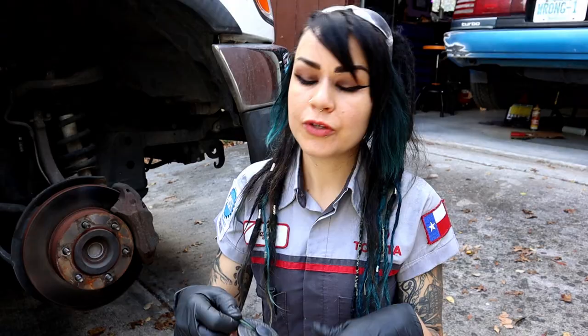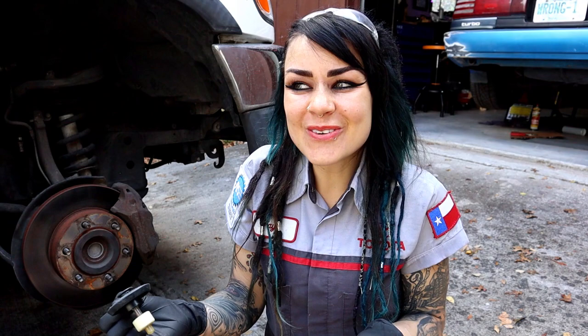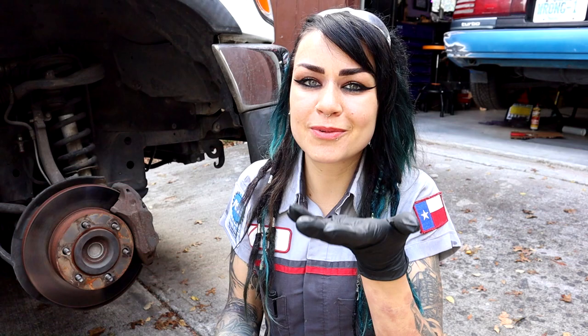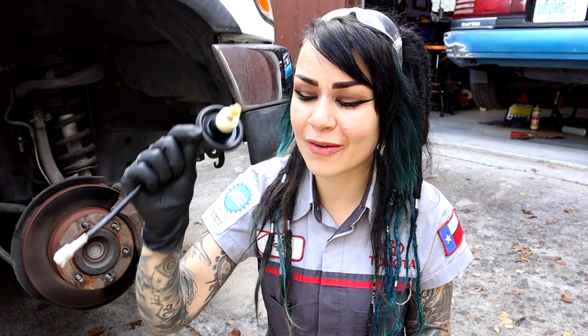Now why does this not work in most situations? When you go to a dealership or independent shop for an oil change and they do a full service topping off all your fluids, most of the time those oil change people don't know that the fluid level is really important and needs to stay at whatever it was. Also, when technicians replace your brakes or flush your brake fluid, they're often not going to put it back to the level it was before — they'll put it right up to full — so this is unfortunately not a good measuring technique anymore. We can't really trust this.